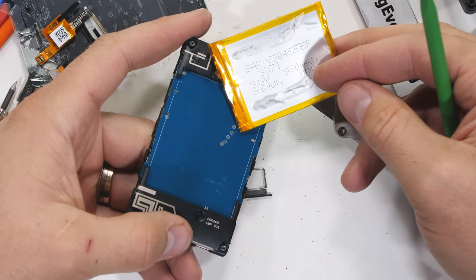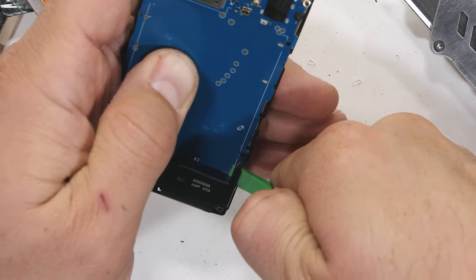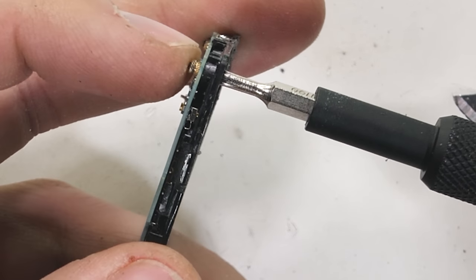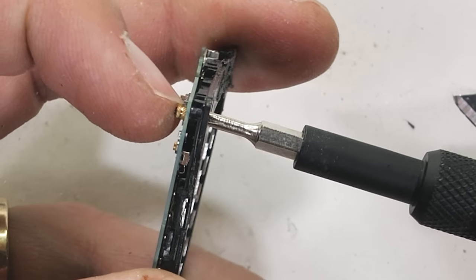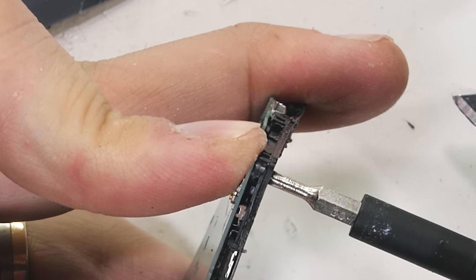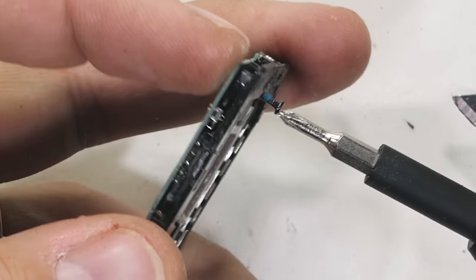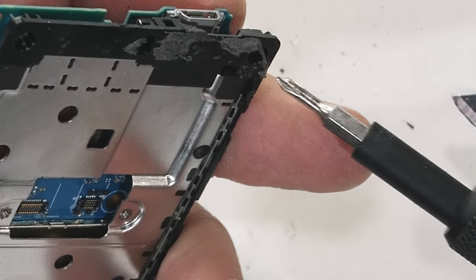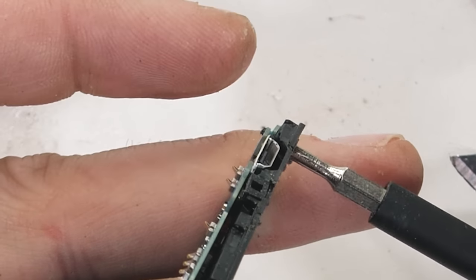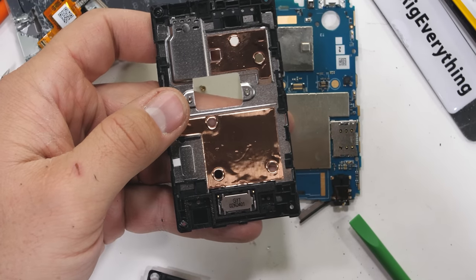I'll remove the two Phillips head screws and unclip the ribbons just like a little Lego — one is for the display and the other is probably for the digitizer. The back of the mid-frame sandwich has the battery, which is gently adhered to the back of the motherboard and is 950 milliamp hours — about three times the capacity of the Apple Watch. I'll pop off the two black plastic end caps. We can see there is a Phillips head screw in each of the four corners, and still attached to these screws is a gold threaded insert. Normally these inserts are embedded into the plastic frame and give something solid for the screw to grip onto, but since I manhandled it out of the housing with force instead of finesse, it just wants to spin freely on the screw. Once all the inserts are pulled off the screws, I can separate the mid-frame from the motherboard — it does have some copper sheeting on it, which is nice.